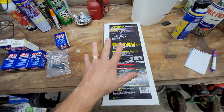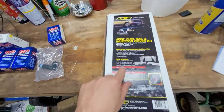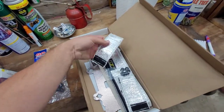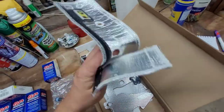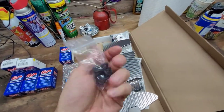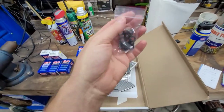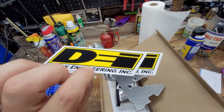What's good about this kit is that if you just want to put the heat shield on without putting in new fuel injectors, you can, because it comes with 12 fuel injector o-rings - each fuel injector has an o-ring at the tip and one up top. Inside the box you get individual wraps for each fuel injector, the large one for the entire fuel rail, and the manifold heat shield with 12 o-rings. Count those o-rings - I did one of these on my other Jeep XJ and it was actually missing one, but thankfully I bought new fuel injectors so they came with a new one.